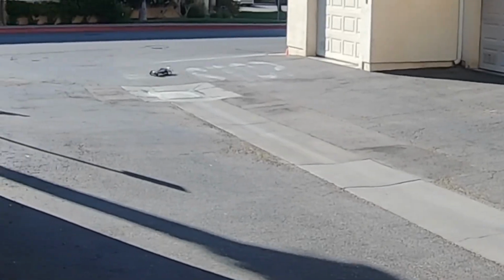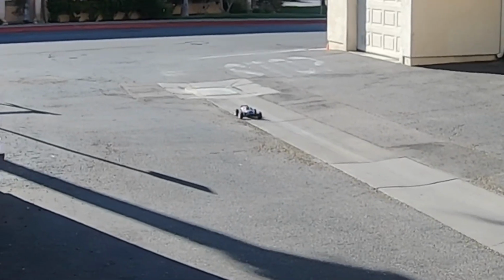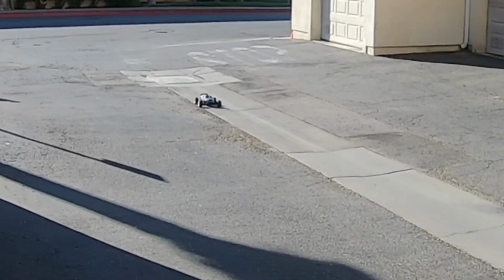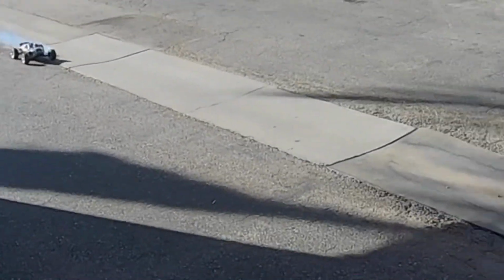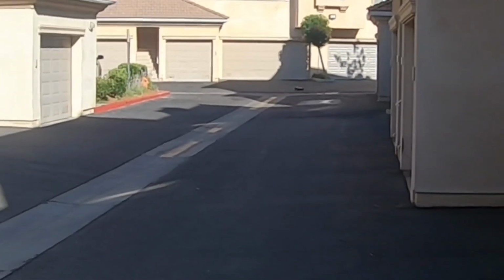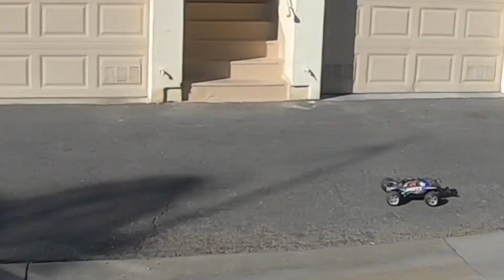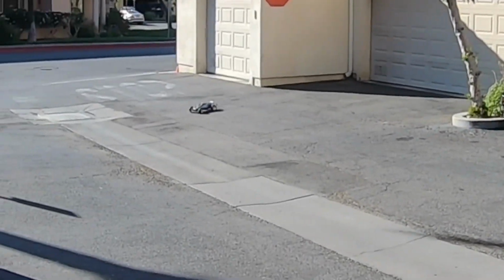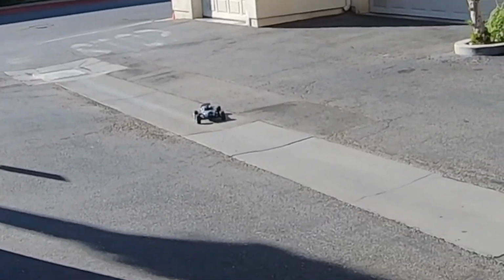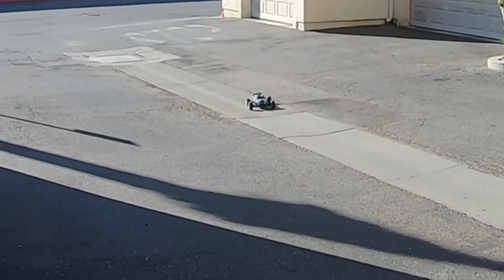And I never touched the high speed needle when making this correction for idle. And that's what I was trying to show in the last video. Hopefully Razor RC sees this and he'll give the low speed needle a shot, because I think that's the biggest tuning mistake a lot of people make, is that they strictly try to adjust the high speed needle and they're afraid to give too much fuel to the low speed needle.